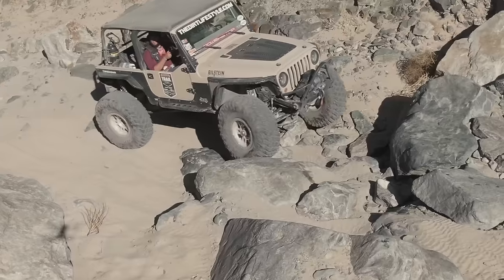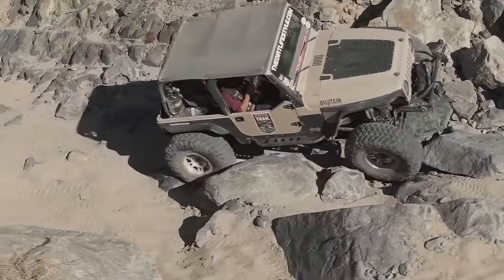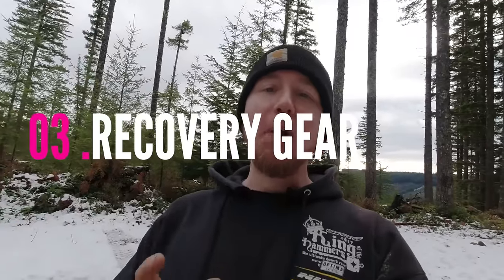When you have low fuel rail pressure caused by a big air bubble, the engine thinks something catastrophic is about to happen and goes into a safety protocol where it will not run. It's only a 10-minute fix if you have the computer, but I had taken it to my hotel room. So I was broken down in the middle of nowhere, had to get a ride all the way back to town to get my computer. Even after 17 years of wheeling and knowing better, I still made this mistake — so don't put your friends in jeopardy. Even if you think it's just a short day, just top off that tank.